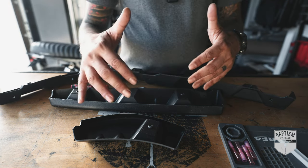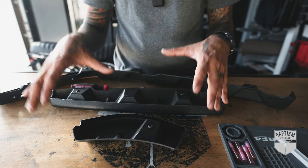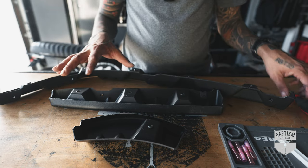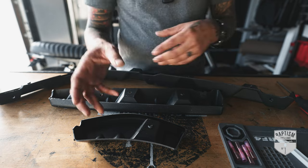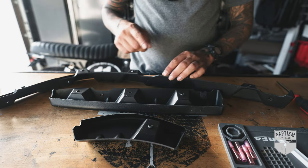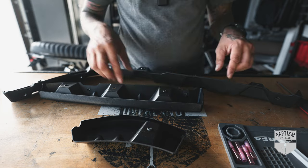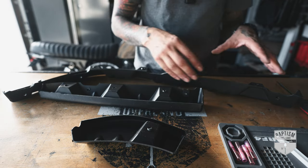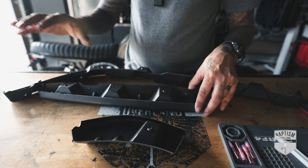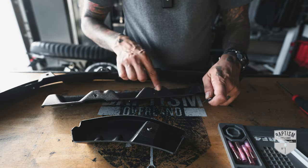I went and installed the flares on the passenger side just to get my bearings. Now we're going to install the flares on the driver's side and I'll walk you through that — it's the same process on both sides. I am not going to be showing you the part of the install where we trim the inner fenders; if you still have inner fenders you want to continue using, just follow the instructions that Bushwacker gives you on how to trim that down. We're going to start with the rear. The rear was a lot easier to install than the front, which involves wiring in some stuff for the lights. The first thing is to find the inner brackets that hold the fender to the vehicle — look for the numbers D6, D5, and D9.